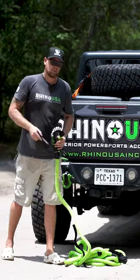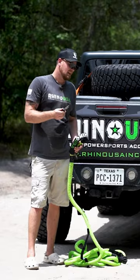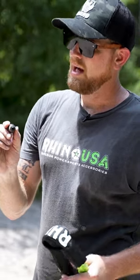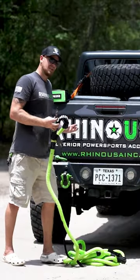I always see comments where people say, just take the tow hitch out and take the drop hitch out, insert the end of your strap into the hitch receiver, and just use your pin. Now, that may work sometimes, but it's not the best option. What happens if you have a really hard pull? This pin will actually bend inside of your receiver, and now you have to cut it out — it's just a hassle. There are better options out there. Use that hitch shackle. It's not going to let you down.